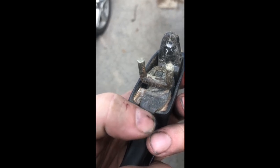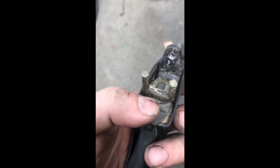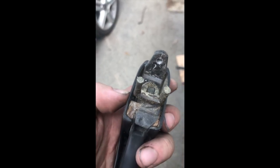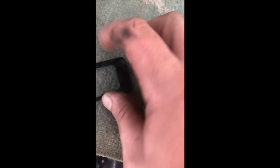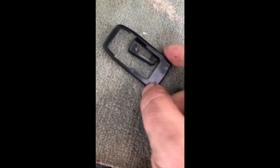Pretty critical piece that's usually missing — it's a little piece of foam, and it should actually be a little wider. That keeps all the water from getting out. I bet that's missing on yours. I don't have a suggestion on where to get that; you could probably use some hobby foam. The aftermarket seals are made by VW Classic Parts and JP Group — they're kind of garbage. This is all you can get from everyone, but they don't last that long. Just letting you know.